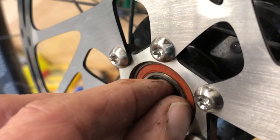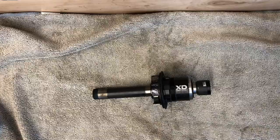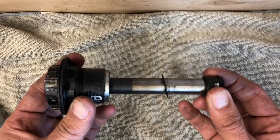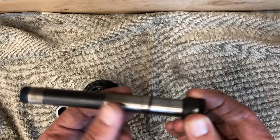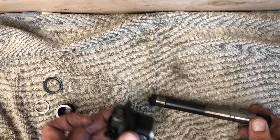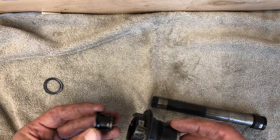That's the whole thing put together. Once you remove that, the axle will just push right through. With the bearings and spacers and everything, you can't over-tighten it — you want to just snug it down, and as long as all the spacers are in there, you should be good to go. So there's a little spacer that goes in between the middle — that's just a little dust cover that covers the XD driver end. There were two small thin steel spacers and then one aluminum spacer. That's how everything fit together with the XD driver.